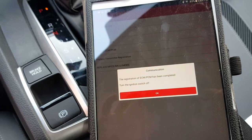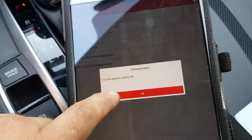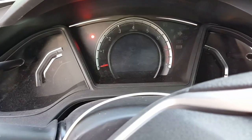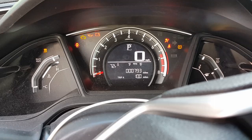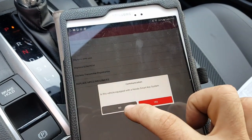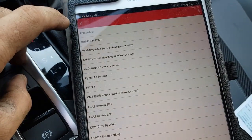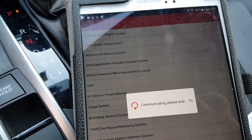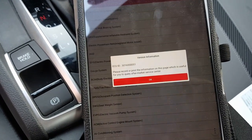It's telling me to turn ignition off, then turn ignition back on. It's telling me right now that the registration of ECM/PCM has been completed. I'll click OK. It says to check and make sure each key will start the engine — I'll hit OK again. It says to turn the switch on and I hit OK. There's one more step we've got to do. The light is flashing again. We're going to go back to the computer — we need to write the VIN number. That's one more step. We'll click on engine system and it will communicate with it.